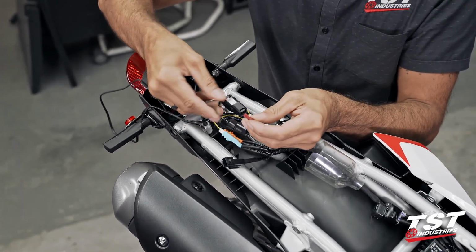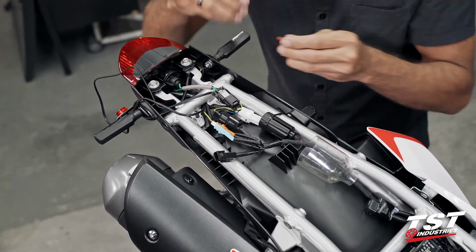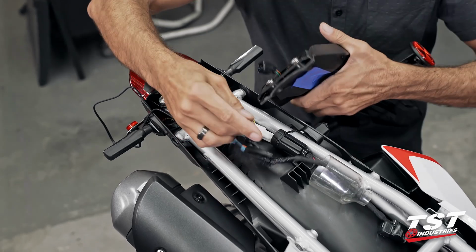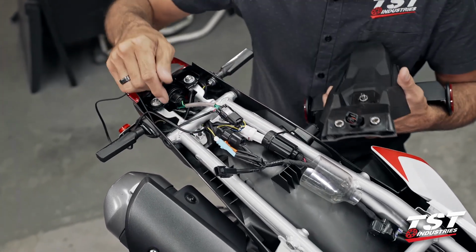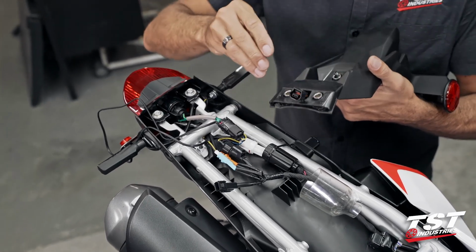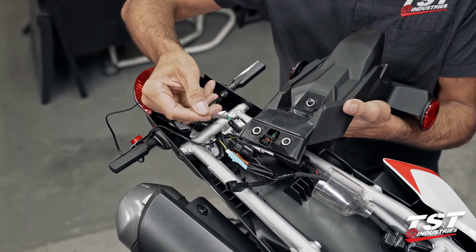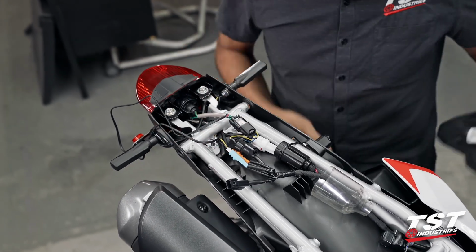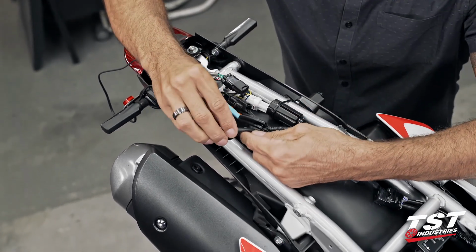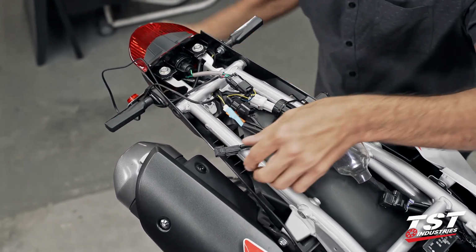And also, when you remove it, it's easy to snake back through and remove physically off the bike should you ever need to. If we would terminate this setup in the same connector as this, then we wouldn't be able to pass it through the little orifice there, and we would have a bigger challenge. So now on this end, we are presented with the option to possibly cut off this connector and then connect this terminating wire into here to plug in. I typically don't like to do that. I just take away some of this housing here, this shielding, and tap in just below. So that's what I'm going to show.